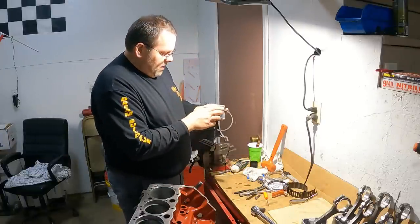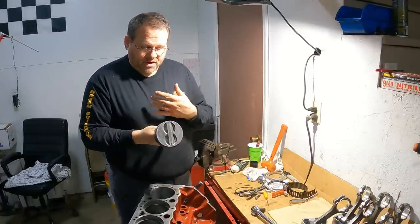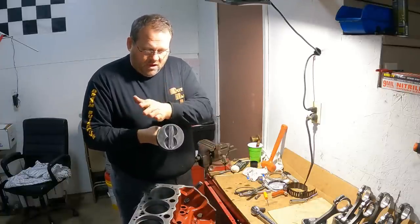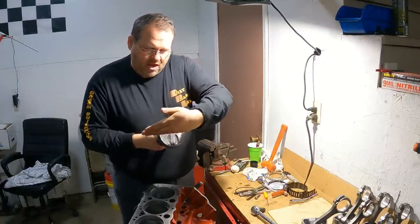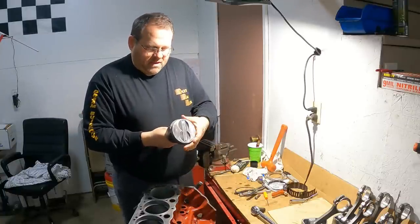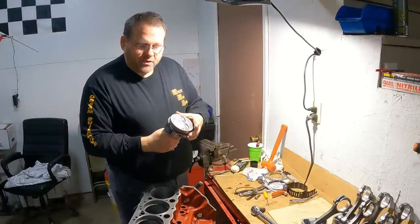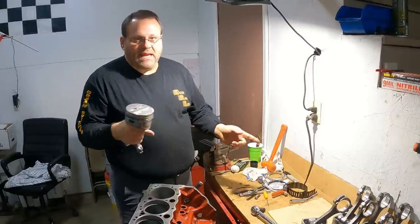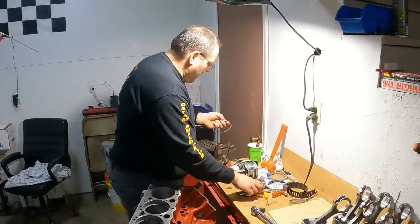It happens. Now, clocking wise, the way I do this, this is just me, it's a preference. So I put my oil expander and my two scrapers at like 12, 10, and 2. And I turn around and I take my second ring and my top ring, and I'll go across ways like 3 and 9, like that, opposite. I'm more interested in my second ring and my top ring just being opposite of each other. Again, they're going to rotate. They're going to cross each other and line up at times and then be opposite again. This is just your starting points, but just my preference, way I do it.